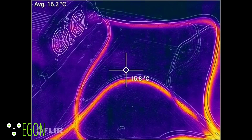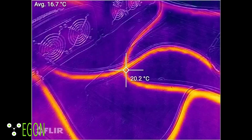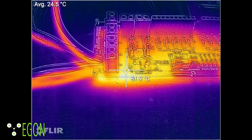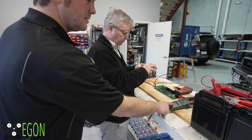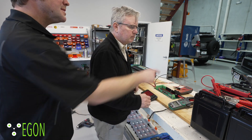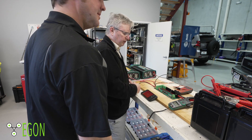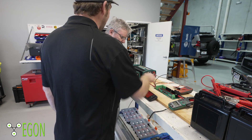The cables are starting to warm up — quite a lot actually. 82 degrees. We are fluctuating at around 150 amps, going from 140 to 170. We've got 12.8 volts at the batteries, 12.3 at the connector — so it's half a volt loss between there and there at 150 amps. That's actually including the cables to the unit itself and that little connector there.